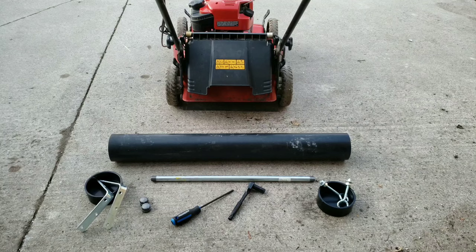Before we get started, here's a quick overview of what we're working with. We have a 4-inch diameter PVC pipe. You're gonna want to measure the outside distance of your back tires — in my case it's 23 inches, so that's what your PVC length is gonna be. Then take your two 4-inch end caps and drill a half-inch hole right in the center of each of them. Then you're gonna take a half-inch threaded rod, stick it through the middle, and it's gonna stick out about an inch on either side of the end caps. Next, take two eye bolts, put those on the end of the threaded rod, then connect that to the two L brackets and bolt that to the flap on the underside of your lawnmower.